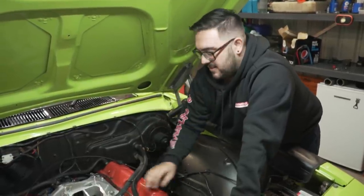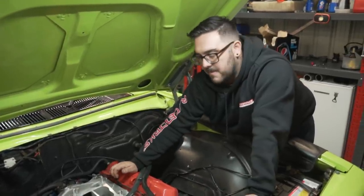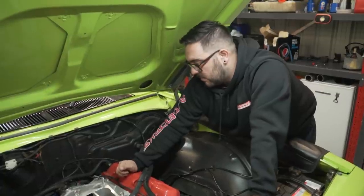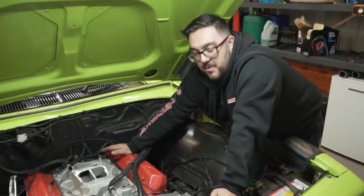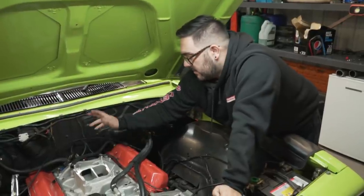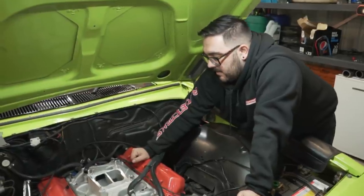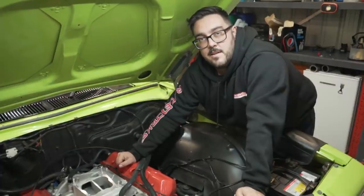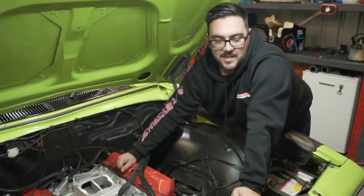It's an easy job changing an intake manifold, we just overlooked drilling those holes. There are actually three holes there - the gaskets had to suit all different types of Holden heads. That was a pretty easy job overall and everything worked out really well. We dropped the dizzy back in but we're not going to put the cap on until we run the fuel lines because we don't know if it's going to get in the way. We're ready to drop the carby back on - we already had it on but we pulled it off just to film the segment explaining how the carby works. We'll drop it back on and explain what we've done for the accelerator cable.